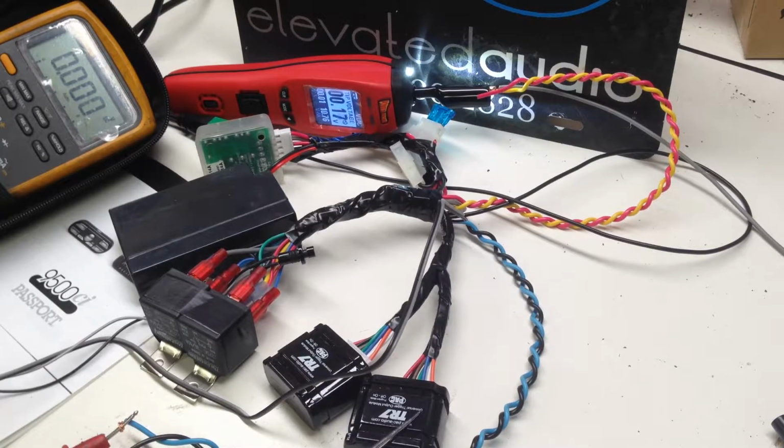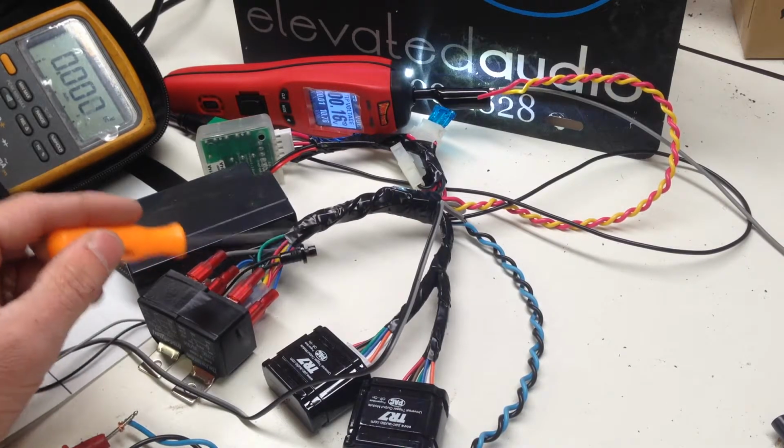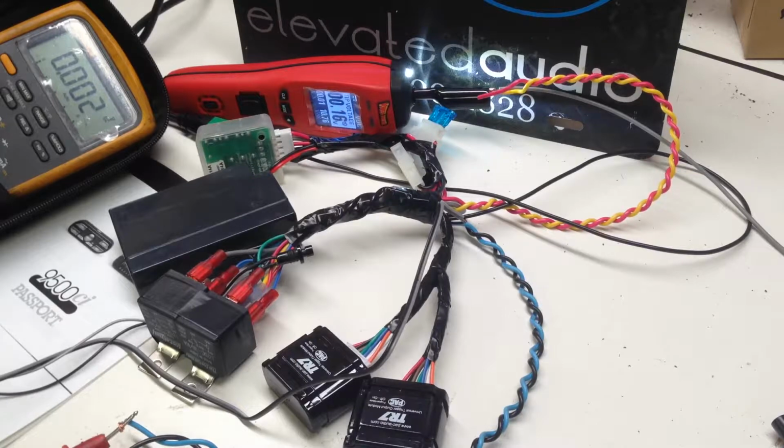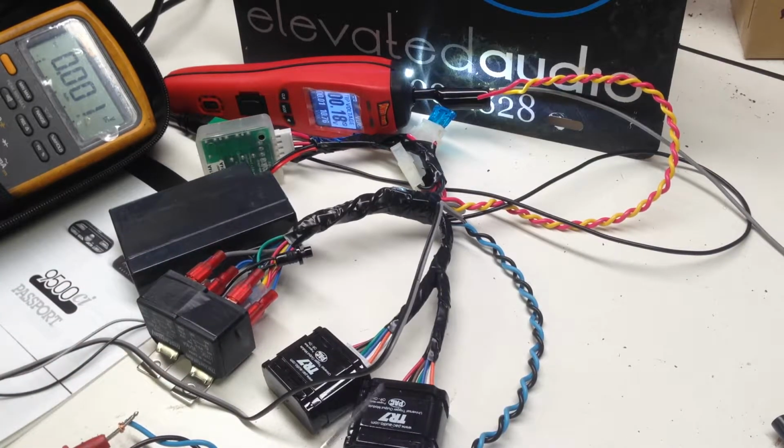Second TR7 here, I like to do this because this little button on top of the 9500ci for the power, it's frustrating to say the least. I mean, you could flush this into a panel, you can notch it out above it, but still, aesthetically, I don't like it. So I like using these little valet switches. I flush mount these, on this car it's going to be on the side panel, right underneath the lip of the center console where you don't see it, but the customer can definitely just tap this button and shut off the 9500ci immediately.